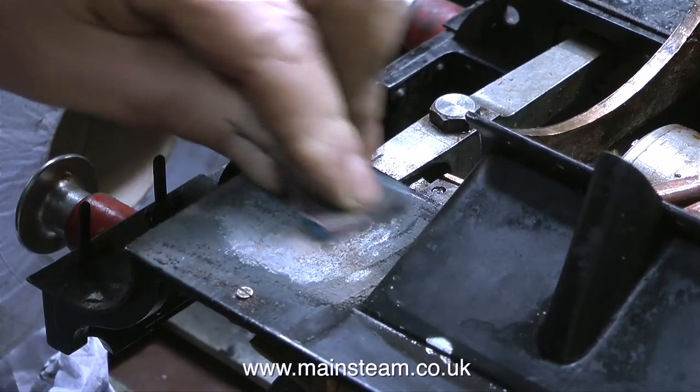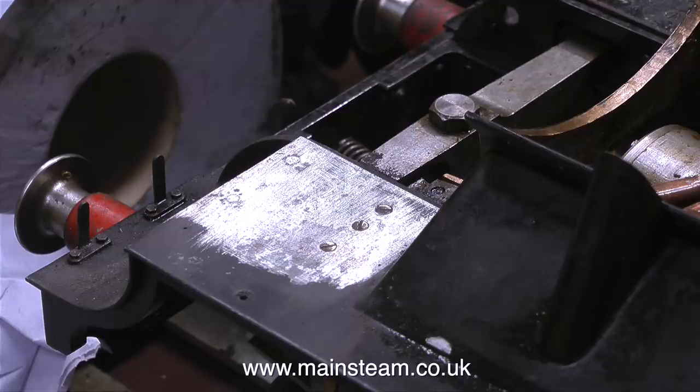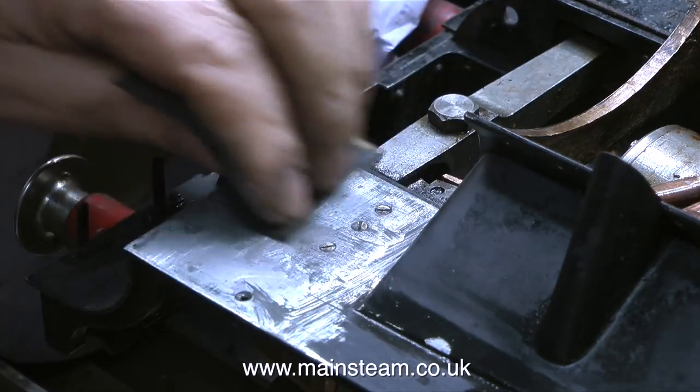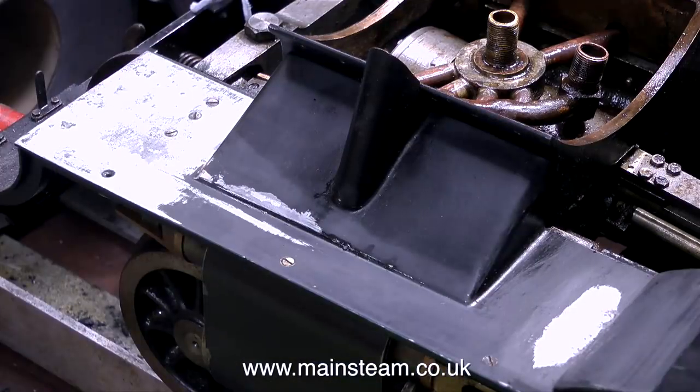The running boards are very rusty in places, so I think it's time to use some sandpaper to remove the rust and get it back to bare metal. I'm cleaning off the paint and the rust with coarse sandpaper to start with, and then using some finer wet or dry sandpaper to get a good finish on the metal. I also need to feather the existing paint — that's why I'm using the fine sandpaper — so that when I repaint the running boards, you will not see the join between the paint and the bare metal.